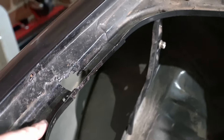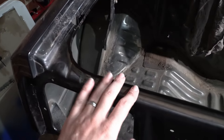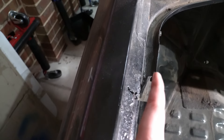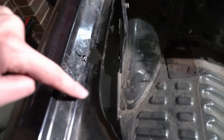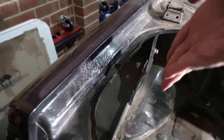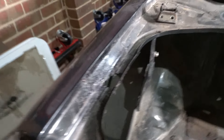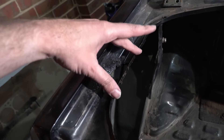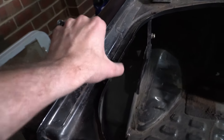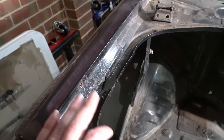This is the boot of the AW11. You can see it's got this lip all the way around where the rubber seal sits, and here we're missing metal - we're missing part of the car. I'm going to have to cut out here and here and replace this whole section. There are some pretty complex bends - you've got one there, one there, one there, and then a little angle and then that piece. That metal bender will be perfect for this. Progress isn't progressing as quickly as I'd like and this is always the way with project cars. Life gets in the way. Check out the shorts I'm doing on YouTube for updates - I showed getting a supercharged deck lid, I've got a new bonnet, a clutch pedal, stuff like that.